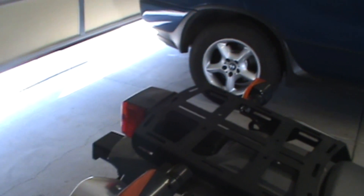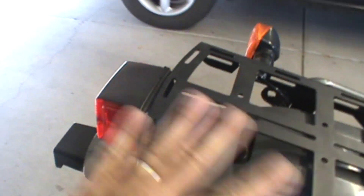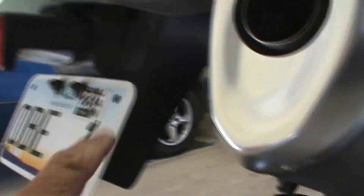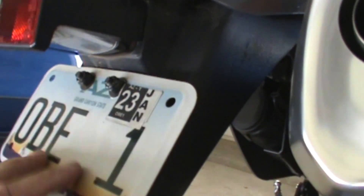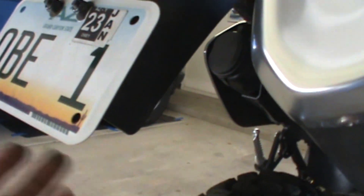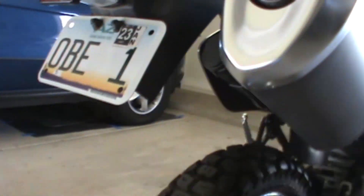This is something very subtle that probably nobody catches. One thing I did is I masked off the top of my rear taillight, painted it flat black, and took the edge off that Rudolph the red-nosed reindeer look. Another thing I did is I cut my rear fender. Depending on where you live, motorcycle license plates might be different sizes. I've got mine tucked up right there — I had to rebolt it and stuff. I trimmed off the edge of the fender about an inch above my license plate. I've got rubber bumpers under there so it doesn't rattle or vibrate, and mine doesn't stick down the other four or five inches like the stock fender — I cut that off.